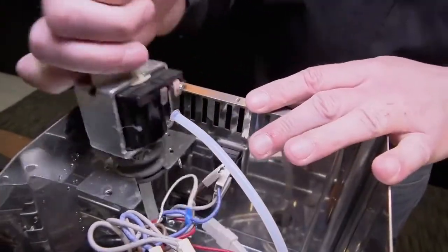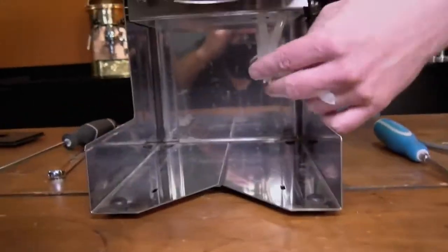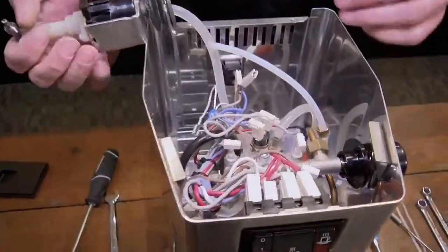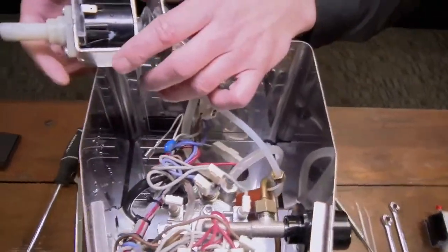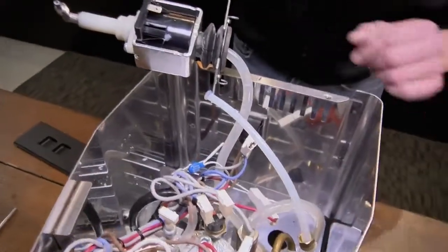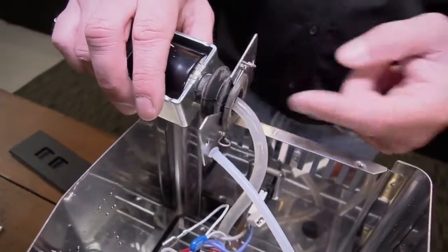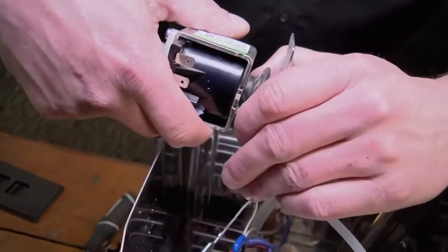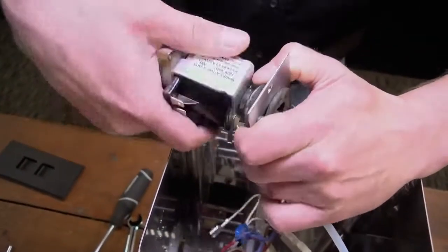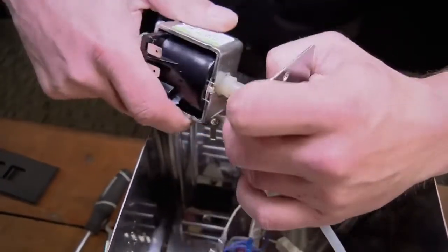After that, we can pull the pump up. You can see how pulling it up brought the tubing up from underneath — you don't want to pull it all the way out because it'll be hard to get it back in that hole. Now we've got to break this rubber boot mount away from the pump because the tubing goes up inside and you can't really get to it. The easiest way is to basically twist the pump and hold the mount — you'll hear it pop as the glue around the neck breaks free, and then you just pull it off.